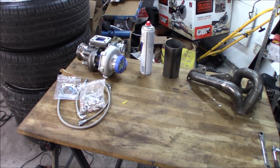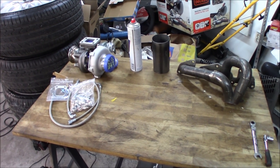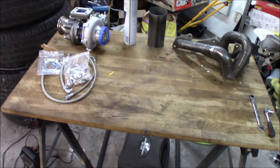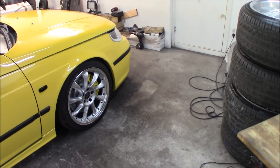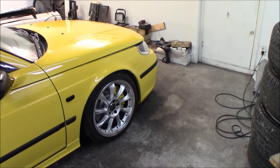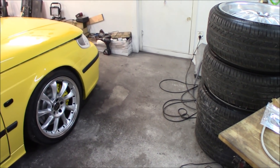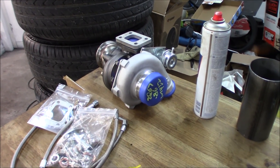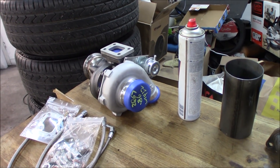First up, some parts we are working with - more parts are coming together with the new turbo but I don't have them just yet. The first thing we're going to do is empty out the coolant and the oil. The oil has been in the car for about a month, just some test driving, and now it needs to be emptied out again. We have the bigger turbo - the GTX 2867R Gen 2.